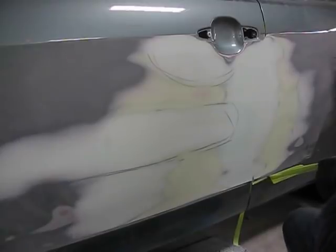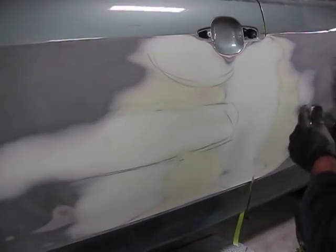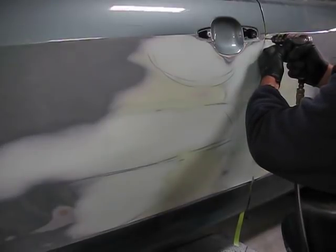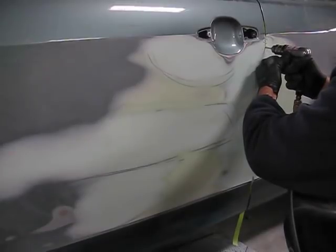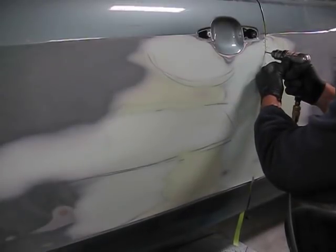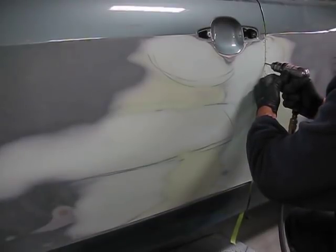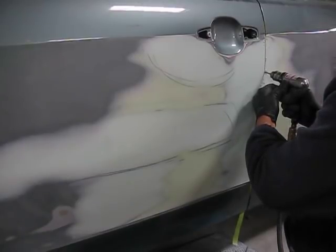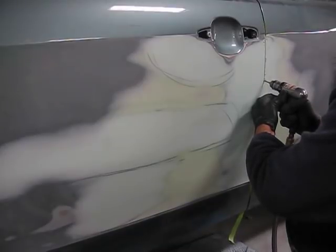We now have the door that we're going to open up with a 1/8 drill bit. Simply hold it up against the door edge and move down carefully. This will cut out a small gap in the Bondo, allowing you to open the door. And then you can remove the masking tape that I've applied in there. And we can finish up the sanding on the edge of the door and on the edge of the quarter panel, and we'll have a job that is ready for paint.